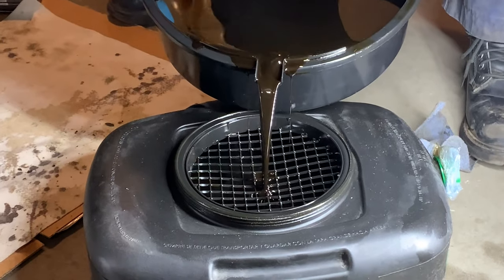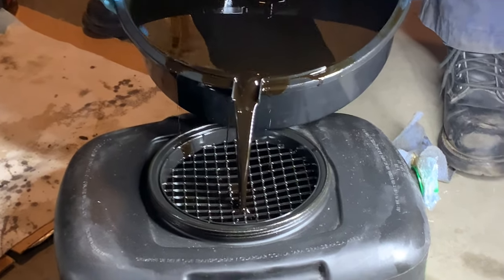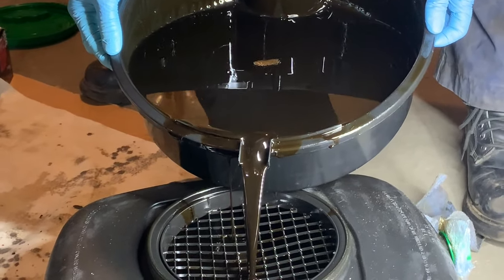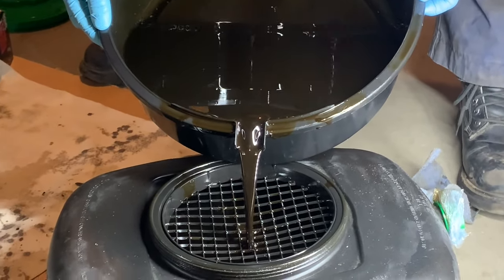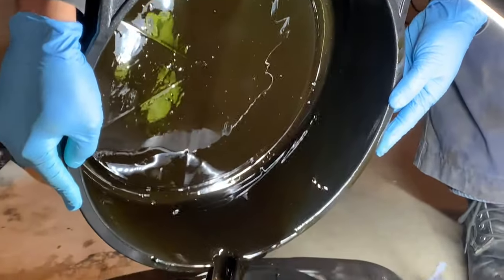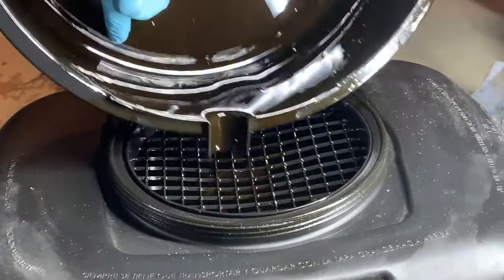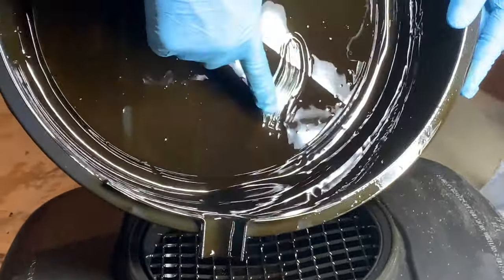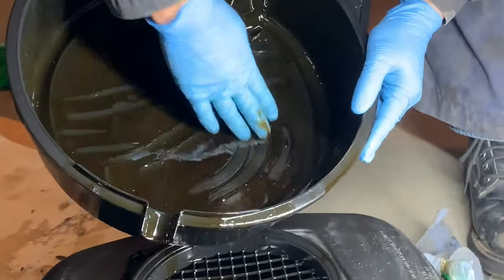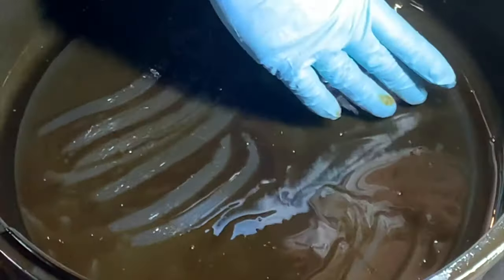Moment of truth — you can see me pouring out the oil here and it is disgusting. It's brown, it's gray — like pouring mud. Let's fast forward and see what it looks like at the very bottom. That's the very end of it, and yes, it's pretty gross looking. Have a look inside the pan — all that shiny stuff in there? Those are tiny metal shards, so definitely some metal-on-metal contact, and it's coming out with that engine flush. Those small tiny spots are metal.